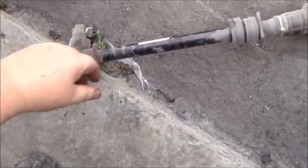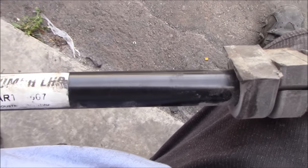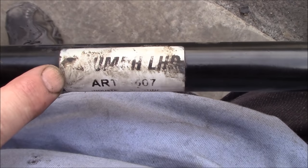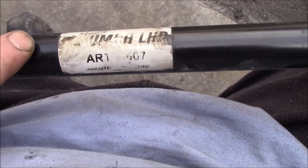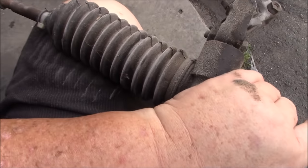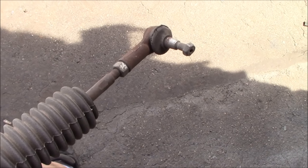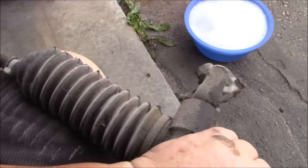We pulled out the steering rack. It looks like it's non-original to the car, but it actually looks fairly new based on the sticker and paint condition. The part number looks like 6607 — Triumph left-hand drive — and it says Industry Argentina. I'm not sure what supplier this is from. I'm kind of hoping it's not a quick rack, because I know they sell quick racks for these cars and I'm not a huge fan of those. Anyway, we're going to clean this up with some soap and water. The boots are in good condition, but I notice one boot is torn there where it looks like it was bashed getting off the car. We also note that this rack doesn't have provisions for the horn ground on the nut — looks like the previous owner did a little jumper for the horn ground instead.